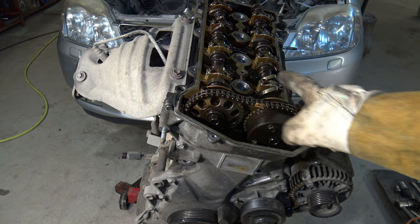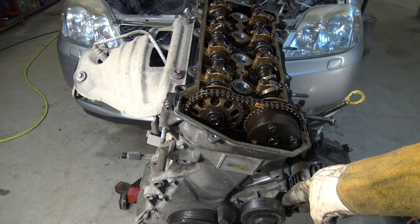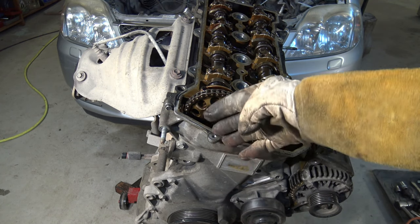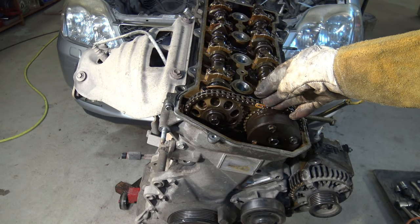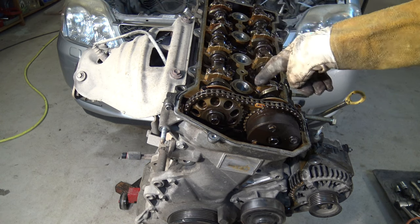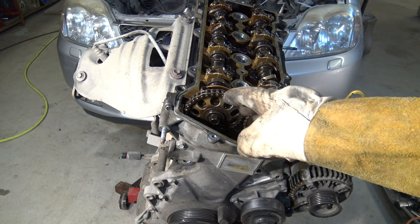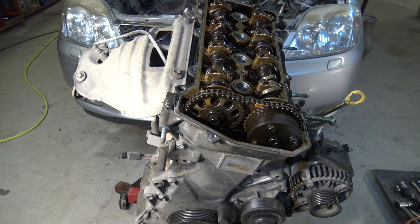And of course, always this rotation is in that way, in the area where we have the water pump, alternator and crankshaft pulley wheel. This is the end area of the engine, and this is the first level, the timing chain and belt. Then this one is cylinder one, piston one, and this is the measurement point, and then cylinder two, cylinder three, cylinder four, and so on if we have bigger engines. And we have to always rotate this engine clockwise. Look at that. Let's go and look.